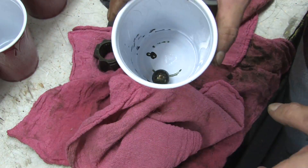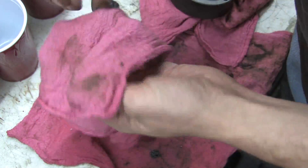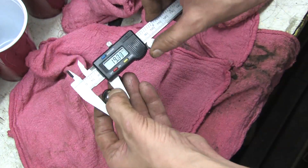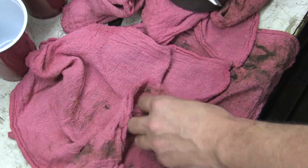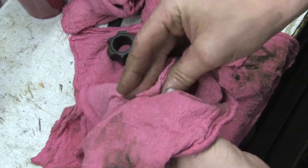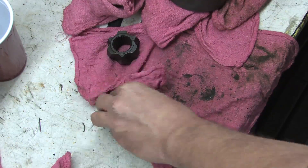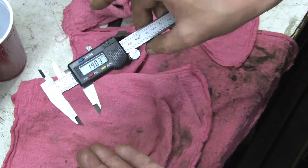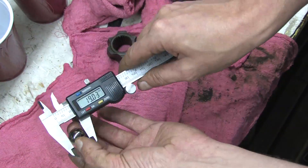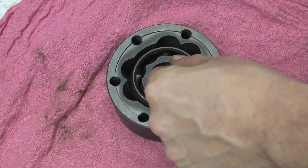The only thing left to do is clean up the balls and cups so we can get clean measurements on six points of each ball. If all measurements match, then this is completely reusable — we'll just reassemble it, re-grease it, put some new gaskets on it and a boot, and it's good as new. I just got the exact same measurement 18 times in a row, so I'm confident. I'm putting this thing back together now.